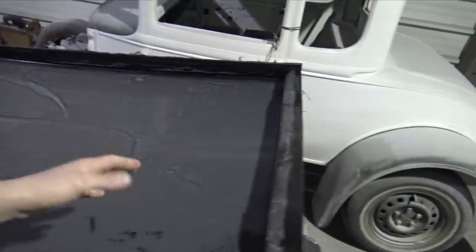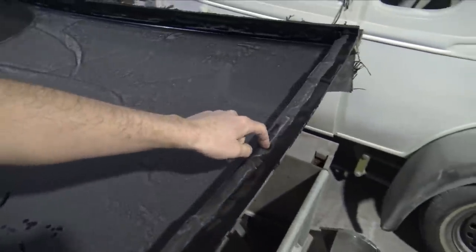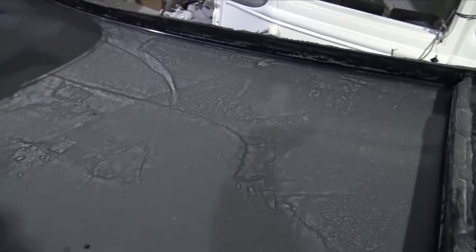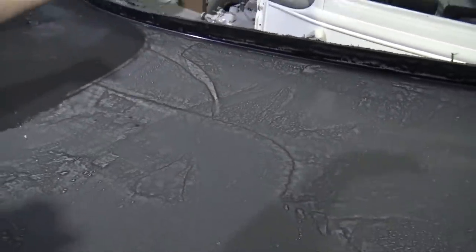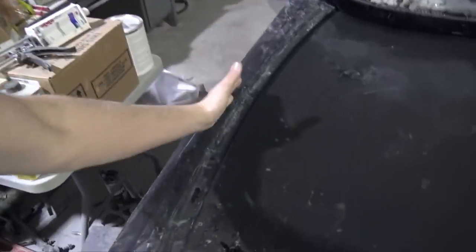So what I'm gonna do is have my resin pull from the center right here. I'm gonna have the spiral tubing run all the way down both flanges on both sides, which gives me a lot shorter distance for it to wet out. So it'll be wetting out from here forward and on the sides on both sides. Then on the front, I'll be pulling vacuum from the front.